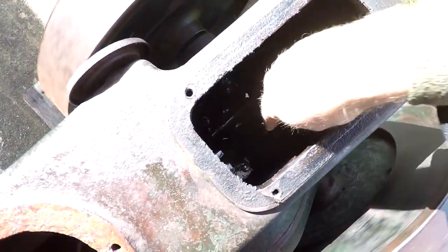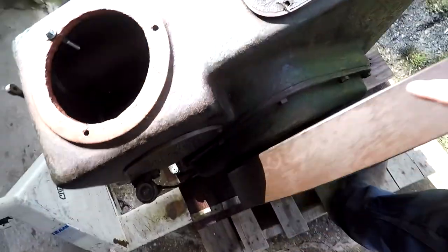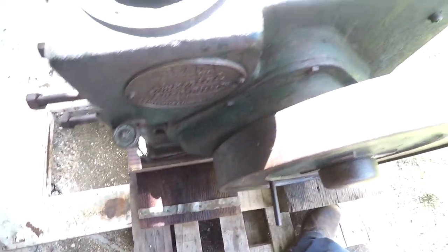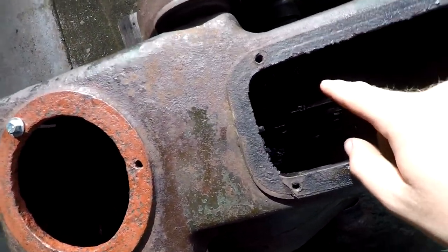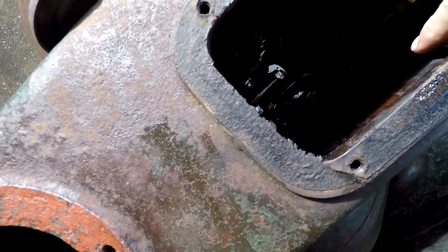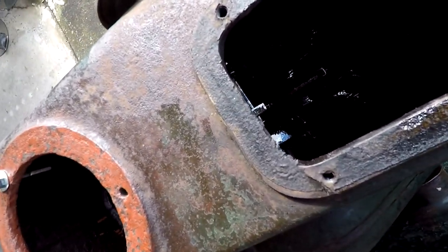This little oil line runs up here. So it's got an oil pump in the side. It's gear driven. There's quite a few gears in here and a roller that actuates a cam that actuates the push rod. There's also an oil pump in there, and it sucks out of the sump obviously, and then there's oil lines going everywhere, so all the crank bearings are oiled.